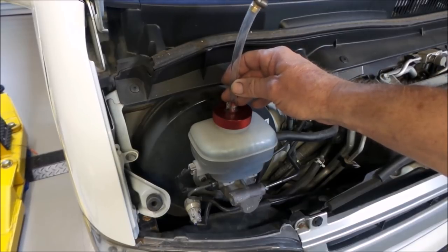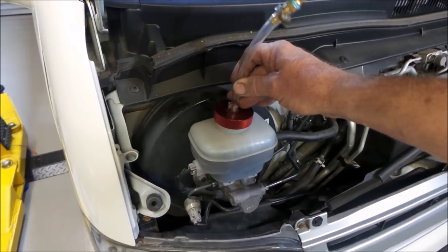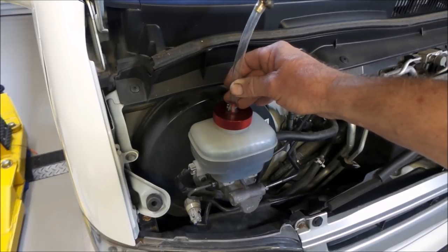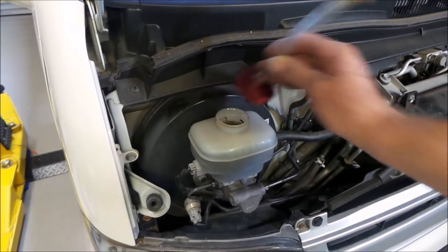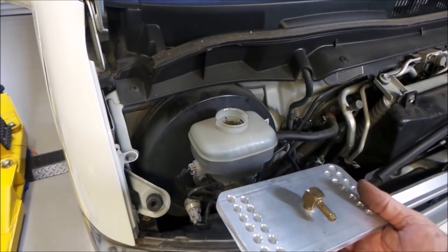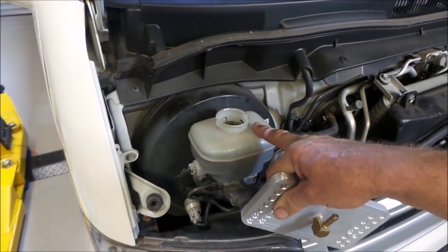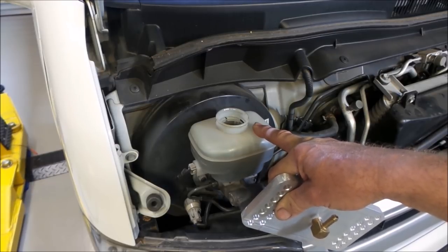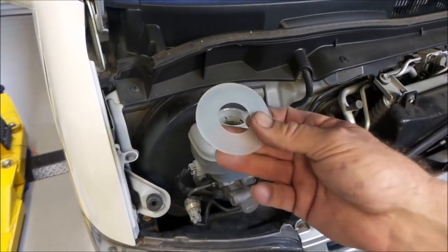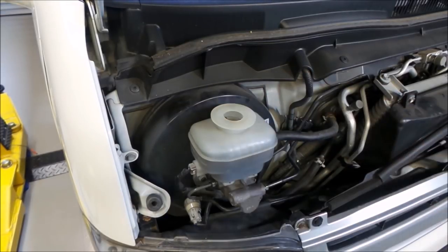So, as I said, there are universal tops similar to the thing that I'm making that will perform the same function, but you have to buy them, and I'd rather make stuff than buy stuff any day of the week. The store-bought universal caps, I had quite a look at this, and I didn't think any of the universal caps that I could see would have actually fitted this properly at all. So you can see how this is going to fit on here. The silicone rubber toilet washer from the hardware store will go over the top of the cap.